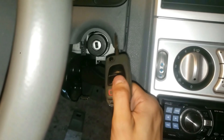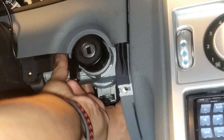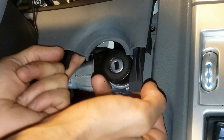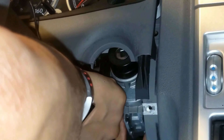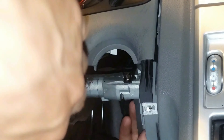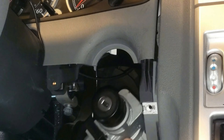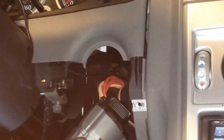The next step is turning the key to zero and removing it. You do not need to remove the key tumbler — this is why we're doing it this way. Now that the key's out, push the assembly further to the right. Move this upper panel piece up just a little bit, and now this key tumbler will clear when you push it. Wiggle it, bring it in towards you as much as you can, and keep working it — it will come out. There we go — and I didn't even remove the tumbler.